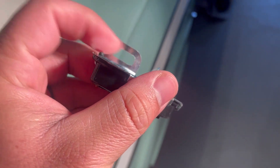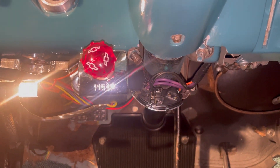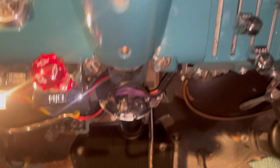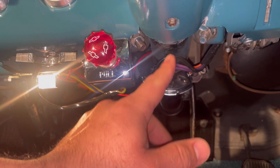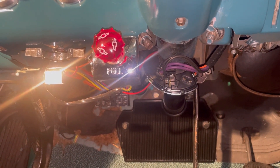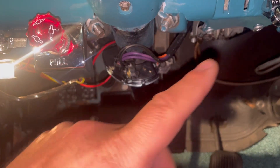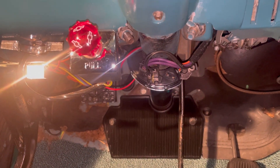The bolts that bolt on here allow you to adjust on the steering column to make sure that the reverse is in the right spot. I just took the neutral safety switch, installed the power, moved the nub over to where I thought park would be, and tried to start it — and it gave power. If you're ever installing one, make sure that the lever, the piece of metal coming from the column shift, is in the correct spot with the neutral safety switch thinking it's in park. Easy install — two bolts. The difficult part was figuring out why it wasn't allowing the car to start when installed, but I believe I just didn't have the neutral safety switch in the correct spot.